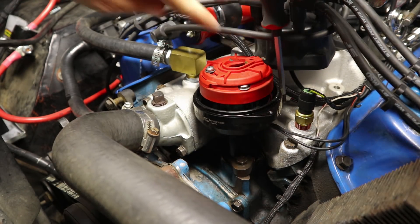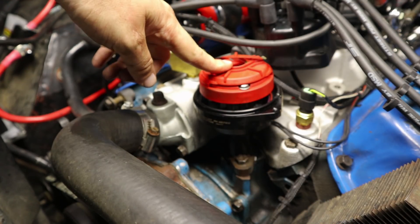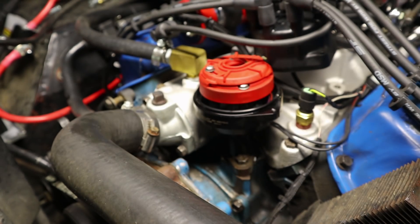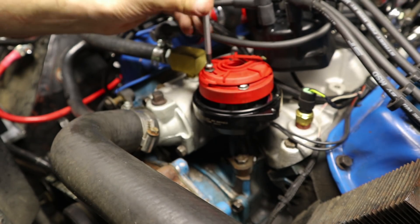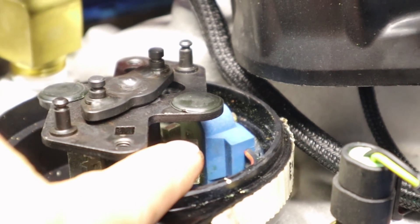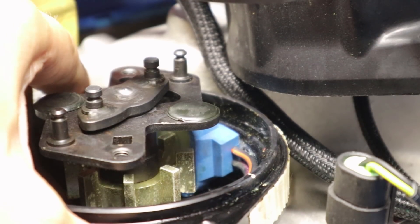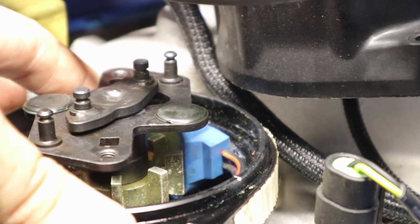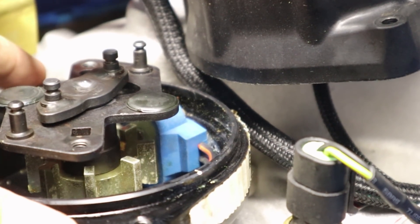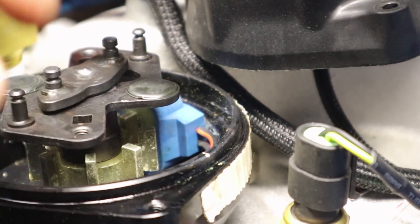Here's my line and it is off just a little bit. Because my distributor is locked out, I'm going to remove this cap and line up the magnetic pickup with the metal gear inside to get it exactly right. Inside the distributor you have a blue magnetic pickup, and if I turn this you see the magnet moving inside. This tooth right here is the number one spark plug, so I want to get that lined up as close as I can where the spark and the magnetic pickup are going to be the closest together.